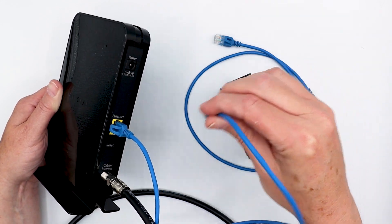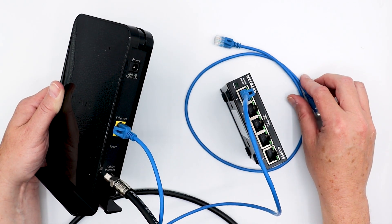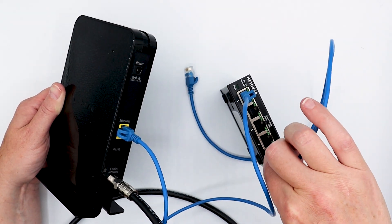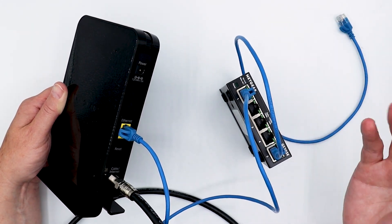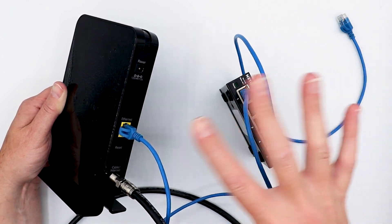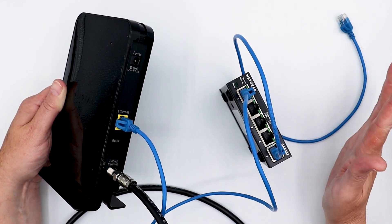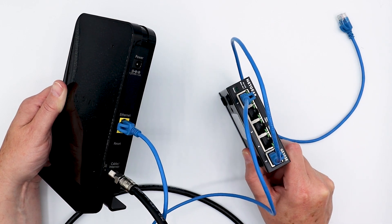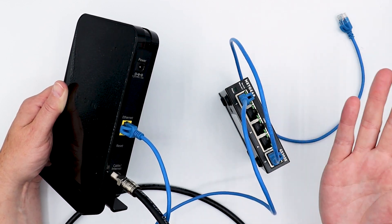You would then plug your Ethernet cable into the WAN port on your router, and then you've got these four switch ports available. Take another Ethernet cable, plug it into any one of those ports — they're all equal — and then you can connect your TV with this cable, plug another cable in and connect your computer, use port three and plug in your Xbox, and there you go. After you get all these connections made, the sequence of powering it up is: plug in your power to your cable modem and give it about three minutes to come fully up. After that's done, plug in your router, and it's going to take a couple of minutes to boot and find out where everything's at, and then your system should be ready to go.